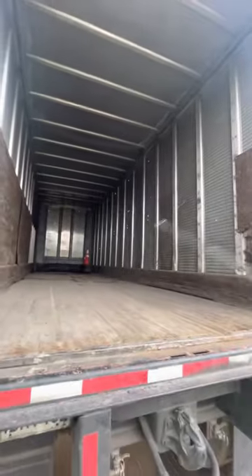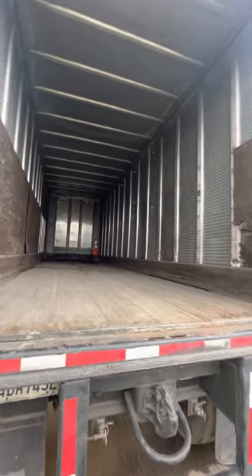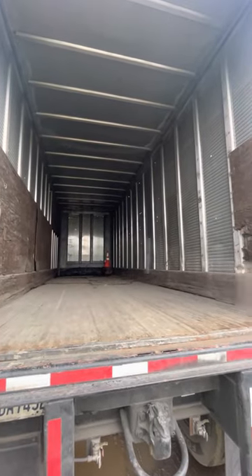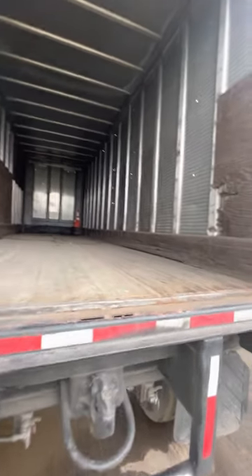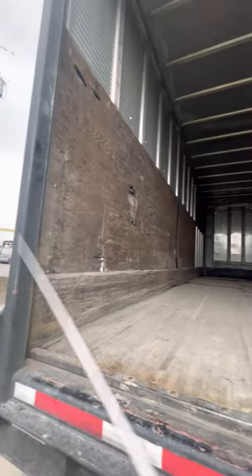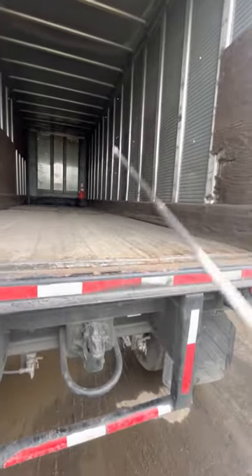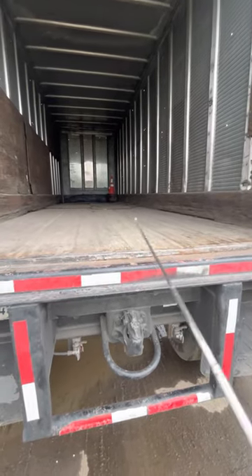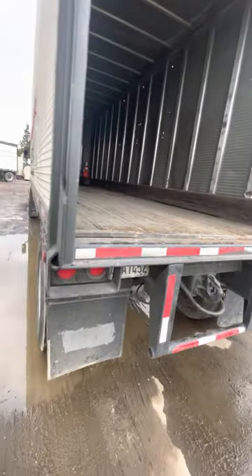My door is under construction and poses no damage to the public. If my door was here, this is how I would say it: my trailer door rolls up and down easily, all rivets are pressed to the frame, not broken, not damaged, in good condition. My tension cables are secure, not torn, not frayed, not missing, in good condition. My latch, strap, and handle are secure, not broken or damaged, all rivets are present. That is the end of Form C; I am now going to move on to coupling.